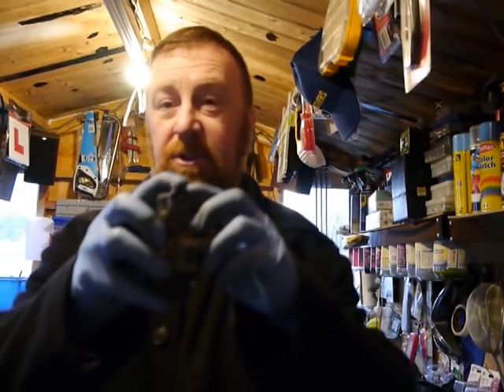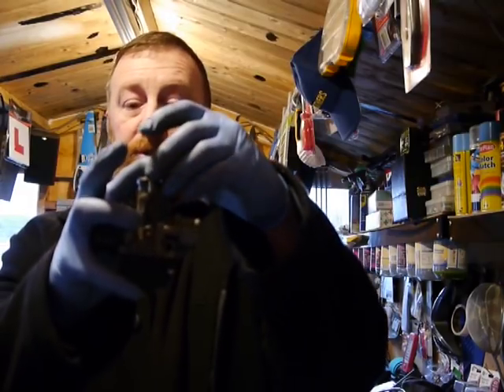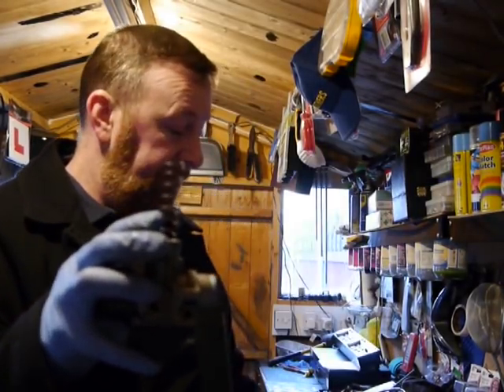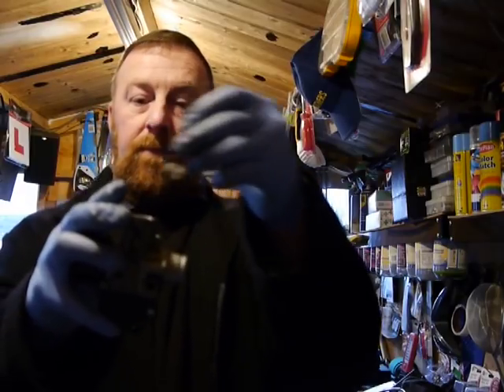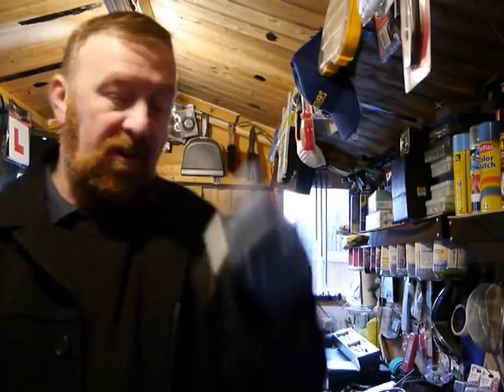For illustration purposes, inside the shed, we've got this carburetor here. Undo the two screws on the top of this one and you'll get a big spring. And the spring then, with this little bit here — obviously the cable's not on here — and out comes the slide.